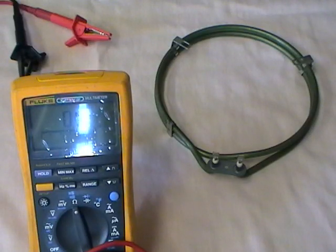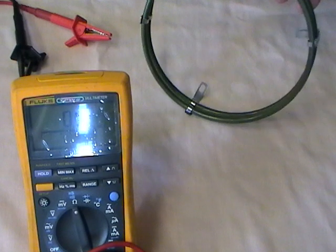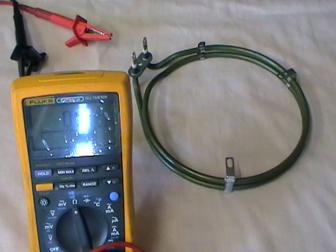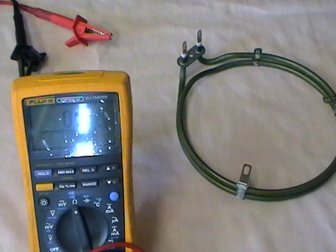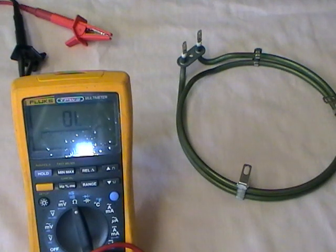Under normal circumstances you won't need to test this element. If yours has failed, they usually fail around the element — the earth collapses and it completely disrupts the surface. Sometimes you get a hole blown in it and quite often the element is completely distorted and bent, so it's quite obvious usually that your fan element has failed. If your fan element does fail on your cooker or oven, the fan will run with no heat and the control thermostat light on the dashboard will be constantly on.